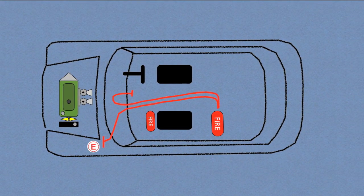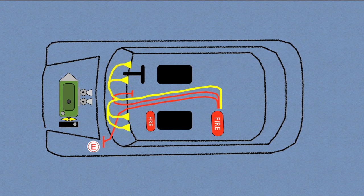To prevent the fire extinguishers from being activated accidentally, they can be fitted, in the case of a mechanical system, with an R-clip. However, before entering stage arrival, the pin must be removed so that the system is armed. In the unfortunate situation where the plumbed in fire extinguisher needs to be triggered, the foam will pass down tubes mounted within the car towards the nozzles. Two nozzles will be aimed at the driver's footwell, and two nozzles will be aimed at the navigator's footwell.